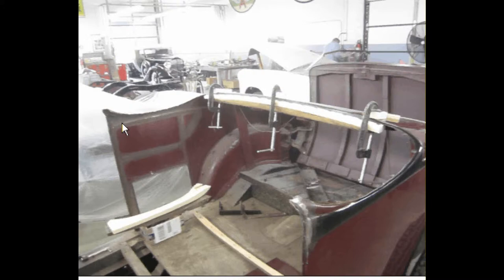I didn't do anything preliminary here to show you what the inside of the car looked like before we started taking it apart. But there were big metal castings at the top of the door posts that were actually connectors between the pillar and the piece that runs along the top. They had to be kind of finessed apart. There were actually spiral nails holding the sheet metal into the casting.